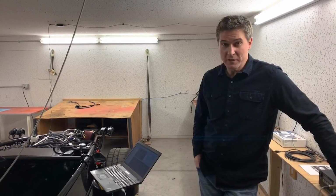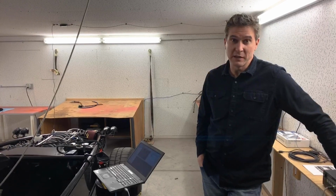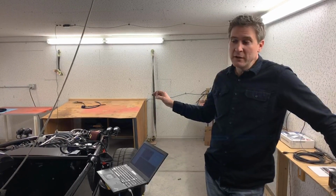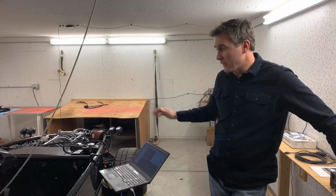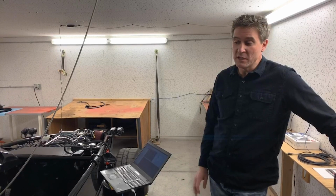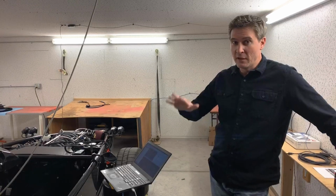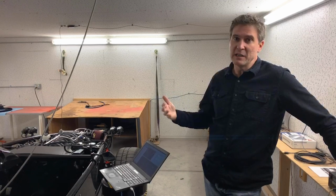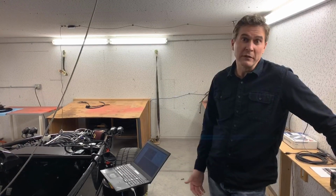When you have 400 horse at the wheels, you don't notice as much because you have power oversteer available on demand. But another thing to remember about these LS3 engines, because they're drive-by-wire, they're actually really easy to drive smooth. You could hop in one of these and daily drive it without any trouble. Overpowering the tires is 100% in control of how you treat your right foot, because the drive-by-wire input is so smooth. It's a non-linear input because it's not connected to a cable, so they can make it so that if you need to drive it conservatively, you can, and it's just not a problem.